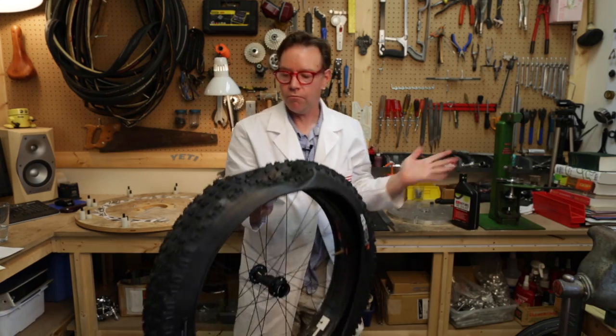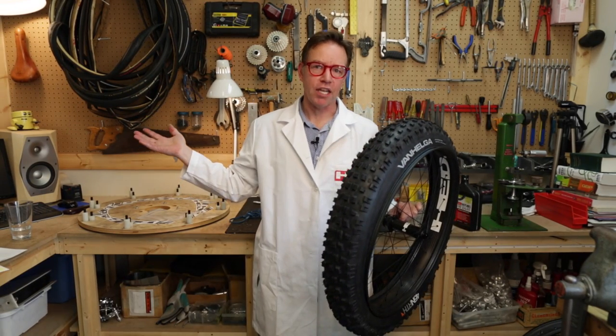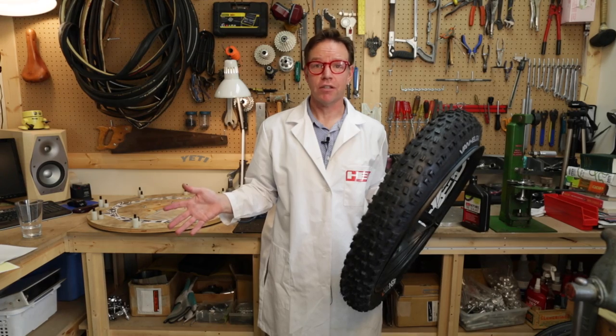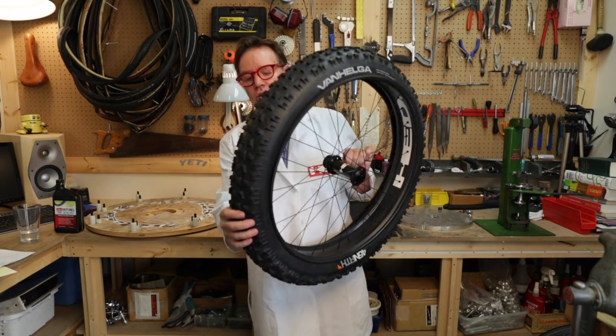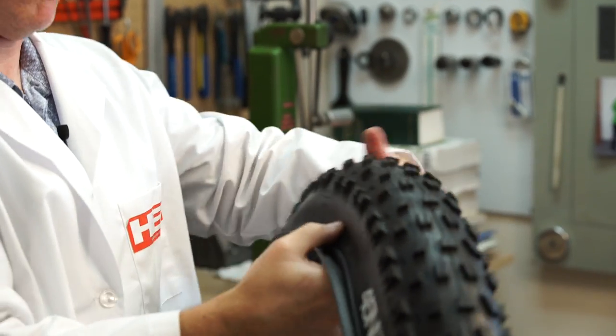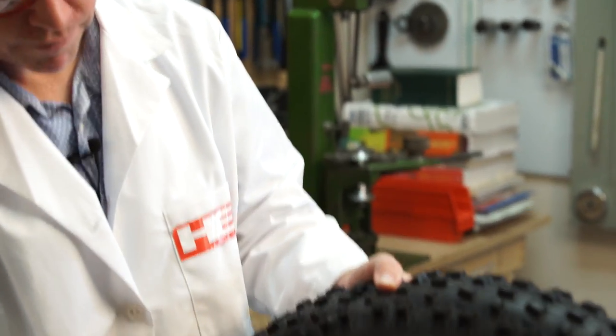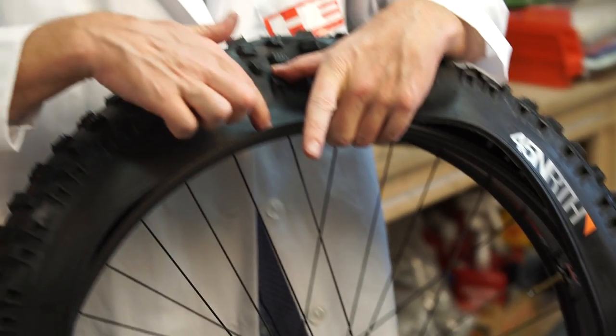One side's on. Now is the time when you want to put the sealant in. Just like other mountain bike applications, you need a lot of sealant — don't try and get away with a tablespoon. Your rim is way light enough already, a tablespoon is not enough. Pour a bunch in there — I usually pour in like a quarter cup of sealant. Then go ahead and get this side of the tire back onto the rim, just like the first side went. Keep the thing down the valley, just push that bead over the lip and drop it down into the V section.